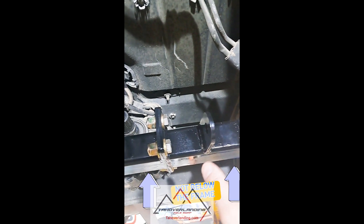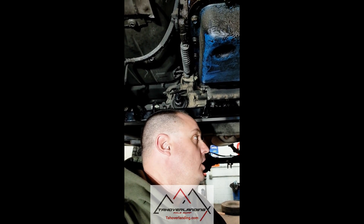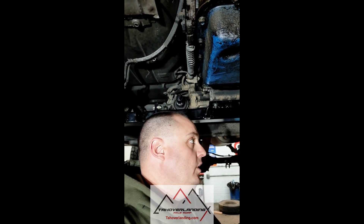Third, that allows the link mounts to be further back and on the front of the crossmember instead of hanging below. Here at Tahoe Overlanding, we hate hanging link mounts below the frame level. We like ground clearance and breakover angle, and we don't want your links hanging down and getting bashed and hung up on things. That is why this crossmember is offered the way that it is.